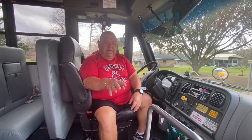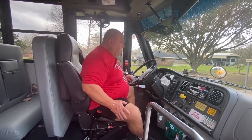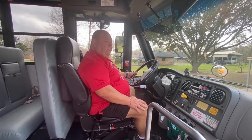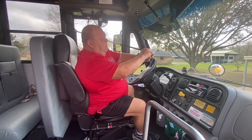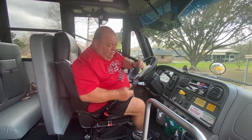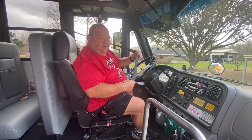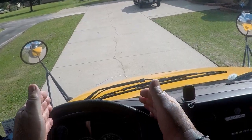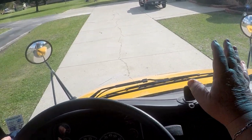After completing the inspection of the outside of the bus and working your way inside, you will come to your seat. Situate yourself, make sure your feet are flat on the ground. Reach over, grab the seat belt, make sure it is attached well to the wall and to the floor, and that it snapped in correctly — the belt should have no cuts, no tears, and no frays. Make sure that your windshield is clean, not cracked or broken, no illegal stickers, and good to see through. Make sure nothing is on your dash for reflection.